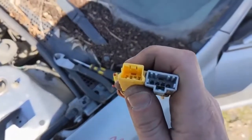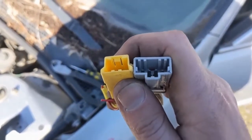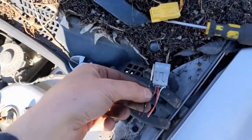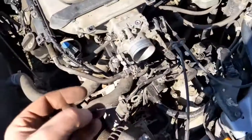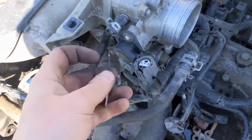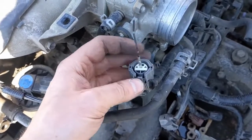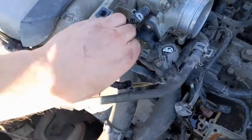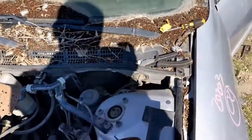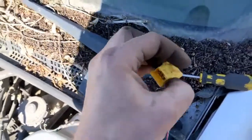Here are a couple of different connectors I found inside. If you look at the yellow, it has much smaller pins than the gray, and the gray has fatter pins — that's what you're looking for, just different pin sizes. I pulled this pin out of the gray connector to show you what I mean. This came out of the inside of the vehicle, and notice it's the perfect size for the female connector on the throttle position sensor on the outside of the vehicle. Same with the EGR — it's the same size pin. So from just that one connector I'm able to test multiple connectors on the outside of the vehicle.